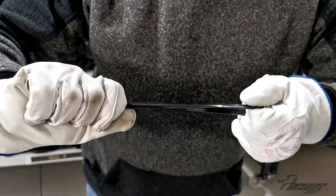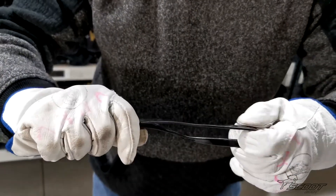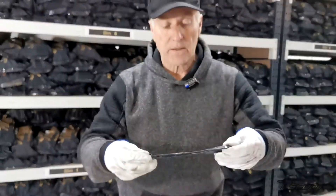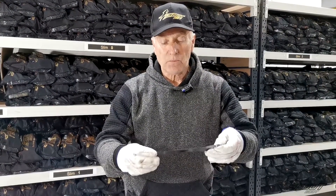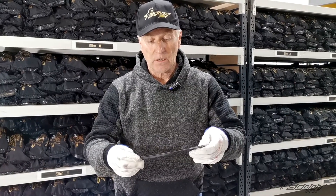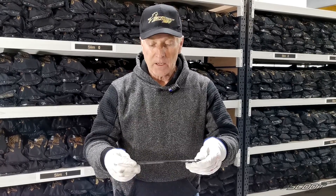You can see how it's stretched — it's a lot thinner there where it's been heated. Now I let the tension off and those mud straps have got an extra quarter of an inch — 10 millimeters — in length. But remember, a loose mud strap doesn't work, so don't overdo it the first time. That's a great tip to save having to purchase another set of mud straps if the ones you have are too small.